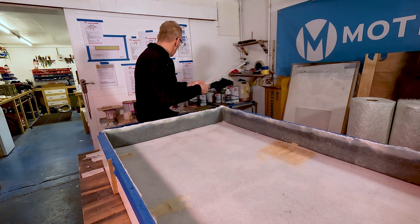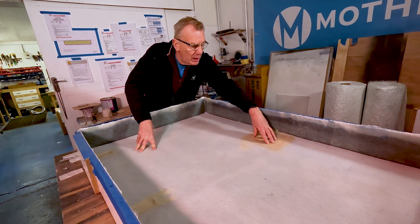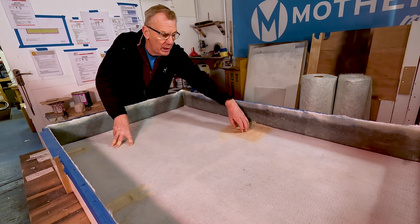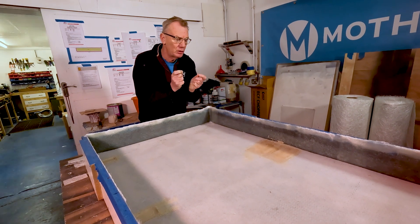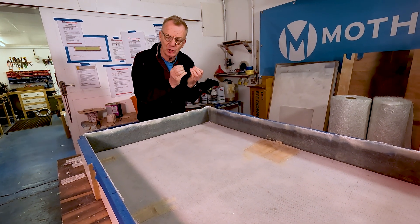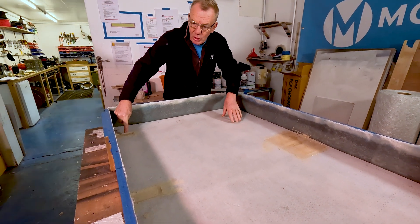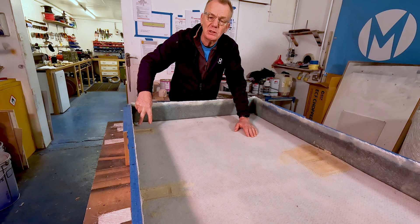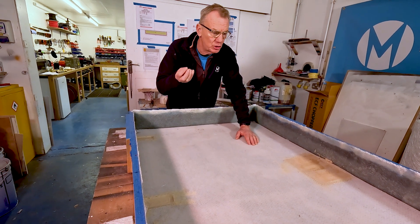Now you'll see some holes in here. That's a bit of plywood because the lock for the hatch is going to go there. Those are things that are bolted together and they just have to have a solid space between them. And then here down here you can see one, two, three — in there's an aluminium plate that we use to screw the hinges in to give us that extra strength.